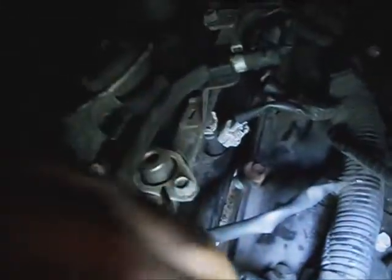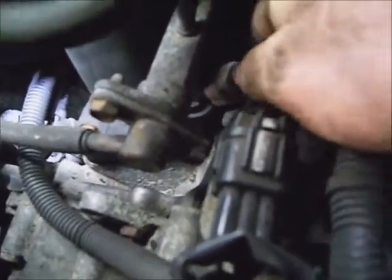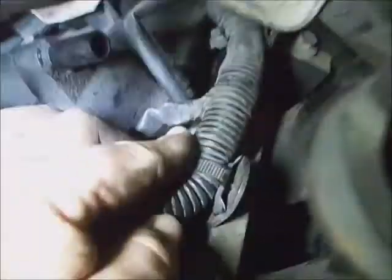Be sure and get them started straight so you don't pin the blades down in there. And the latch is facing the valve cover. And I'll go ahead and bolt the transmission stick back onto it. Start clipping any wire harnesses I undid back into place. Put these front rubber hoses back on the valve cover.